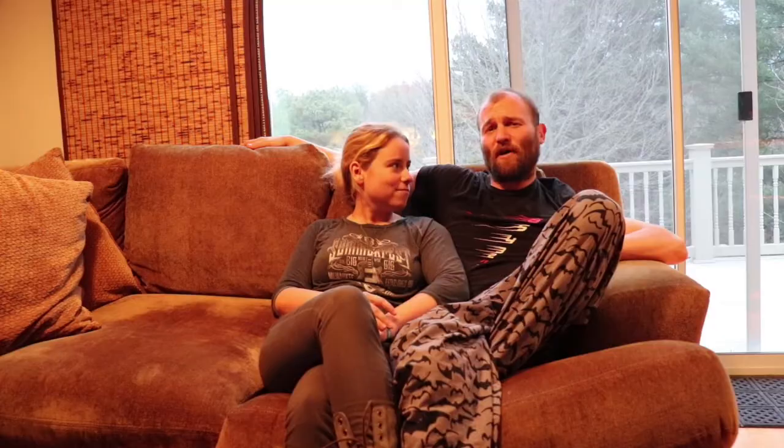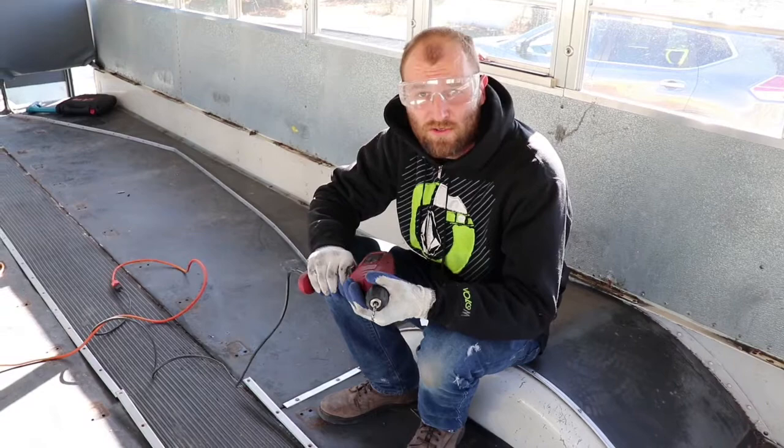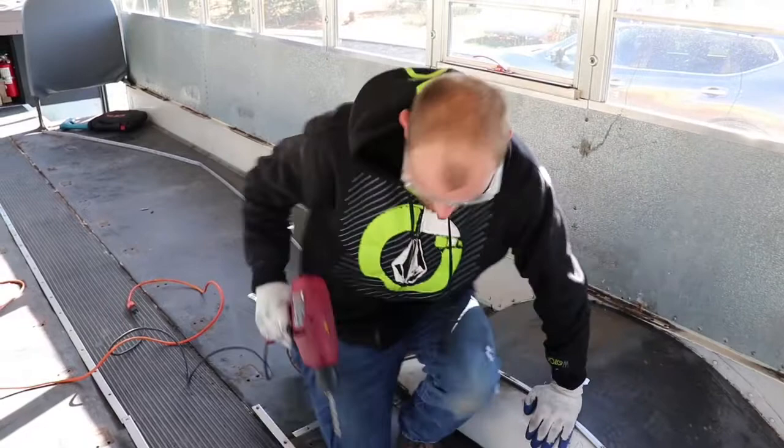What about the panels on the side? We got most of it smoothly at first, pulling all the screws and grabbing off the ones that we couldn't pull out, but then we realized that everything was pinch welded, so we ran into some struggle there, but you will get to see all of that battle. With some of the screws — old, stripped, rusted — the best way to get them out is to drill the heads out.